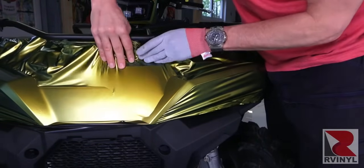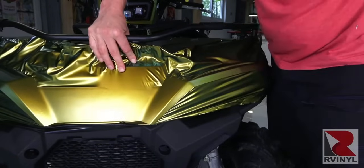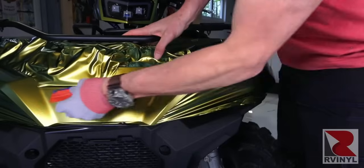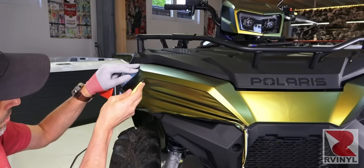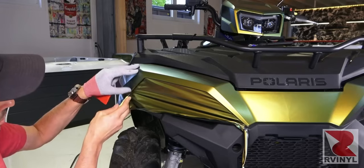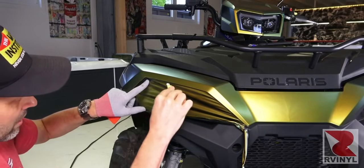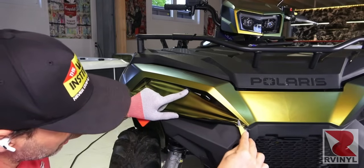So here the material is spread out, and then with an application glove it's fed into the recessed area for no tension. So on minor recessed areas, or ones that don't have severe angles, like this one, even though it looks big, it's actually moderate. But for other ones, they should be fed in. So here the material is being cut flush to the bottom, and immediately the application glove seals the edge. So here the knife angles away and it's cutting the material just flush to the bottom side, nice and clean